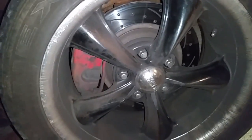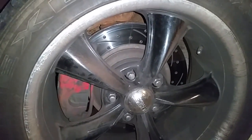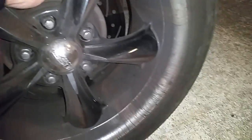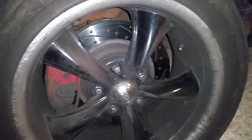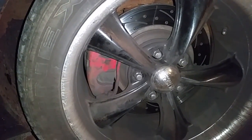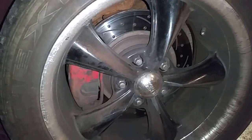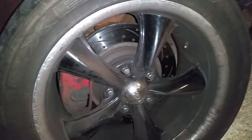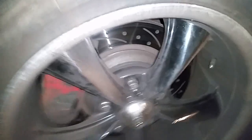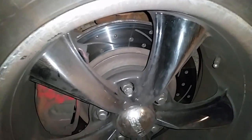Look at this from Classic Performance — this is a hybrid kit. This kit does not require any machining. The C4 rotors have a hat that fits over a stock GM drum hub, so the C4 heavy-duty 13-inch rotors work. They work great — I love these brakes. However, that's an aftermarket caliper, not actual GM. It's supposed to be a C5-style caliper, and those are cheap rotors. C5/C6 requires you to machine down the hub, but it's done fairly easily, or you could take them to a machine shop.